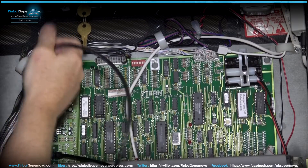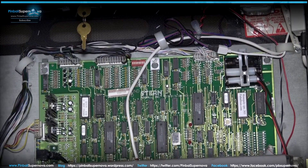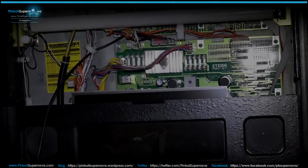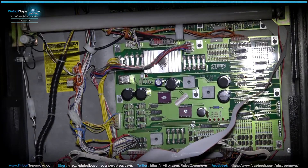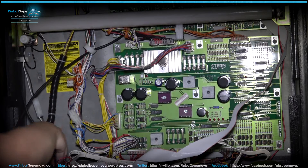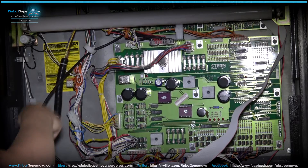Get it past the bulb and put it through the wire harness clamp to keep your wires tidy. Then take down your DMD speaker panel. There's a hole on the left-hand side — drop the cable down into your cabinet and feed it through the bottom of the cabinet to the front of the coin door. Next we'll get to the coin door part where this cable connects.